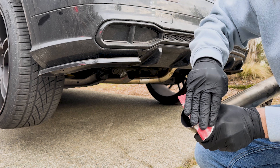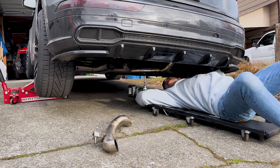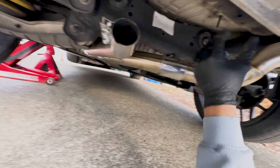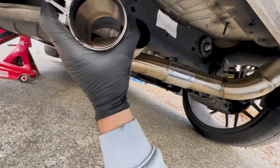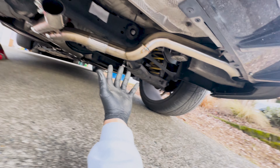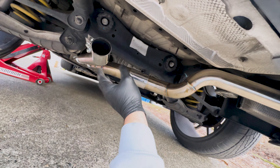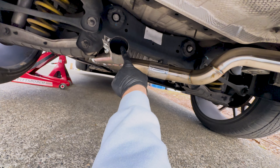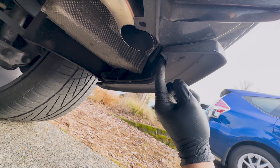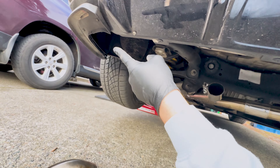What I found out is that these two pipes were positioned too far out and the clamps were loose, so the entire exhaust moved back and went into the bumper a bit. As a lesson for you guys: make sure your clamps are very tight and your exhaust system is properly adjusted. These pipes are not supposed to be touching the bumper — the exhaust is made to fit perfectly just like OEM. Here I am after readjusting the pipe on both sides.